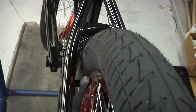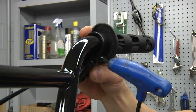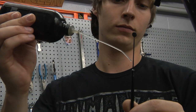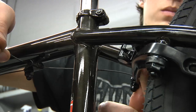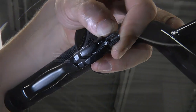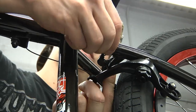Now we're ready to adjust the brakes. For our demo purposes, we'll set up a brake that's a bit more hands-on. The brake lever is a good place to begin your adjustments — reposition the lever at an angle that the rider prefers. If you have some, put a few drops of lube in the cable. To attach the brake cable to the lever, be sure the brake is disconnected by detaching the straddle cable. Loosen the barrel adjuster, lining up the cut with the cut in the lever. Insert the barrel end of the cable into the lever and feed the wire through the cut in the brake lever. Tighten the barrel back down and reconnect the straddle cable.